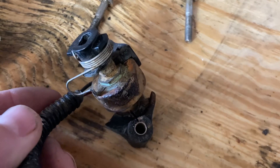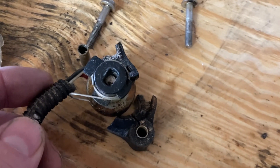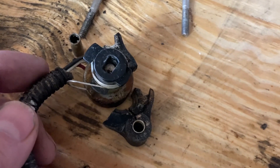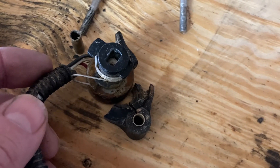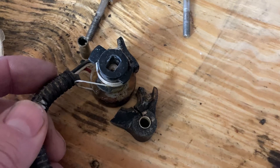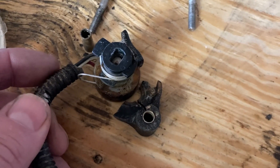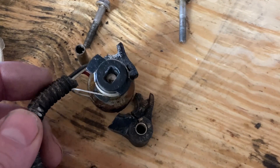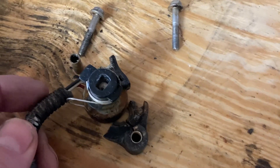I'm going to show you how to repair a TPS. The main part that fails is the plastic housing around the actual unit. That black plastic is at least 20 years old — 19, 20, 21, 22 years old — and it just degrades over time. This is one that came off the latest Genesis I purchased, and it was in a zip-lock bag in broken condition. You can buy these on eBay and different places — you may get lucky and find one in the $125–$150 range, but I've seen them go for as much as $300–$400. Repairing these makes a lot more sense.